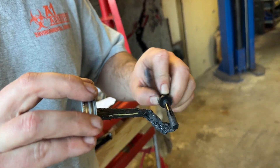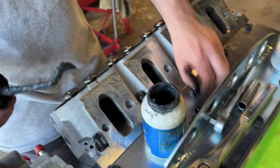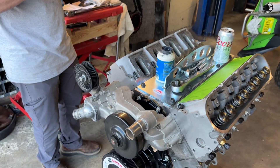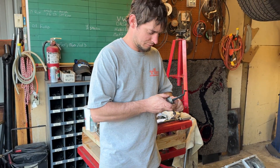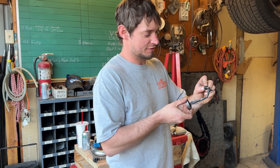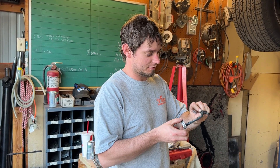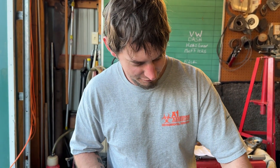Christian is putting the last of the ARP lube on the small bolts - those will get torqued to 25 foot-pounds. We already went through and torqued all the big bolts in increments of 25, 50, and a final torque of 80 foot-pounds. This side's already done and taped back up. Once that's done we'll put the rocker arms on, lay the valve covers on, and call it good until we get some more goodies. Super secret stuff - it's gonna look cool. Maybe we'll call it 'Turd Ferguson' - it fits, the brown projectile.